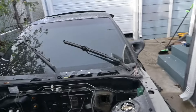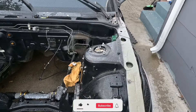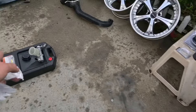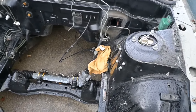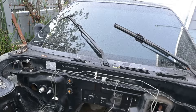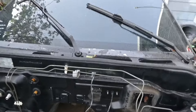It started raining, but this weather's stupid right now. Hopefully it stops soon. So yeah, the whole plan is basically to upgrade the brake booster - I'm gonna see if I could probably run a Z32 one because I have a Z32 master. I'm gonna get rid of all these brake lines, I don't like it. When I have the swap I want it to look clean in here, so I'm gonna go ahead and get rid of all these brake lines right now and start taking them off.